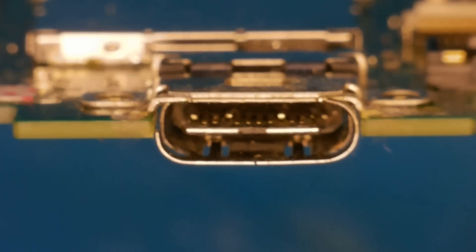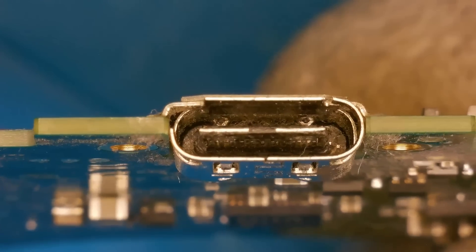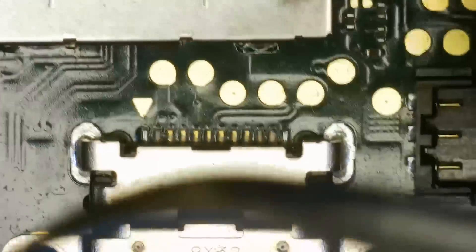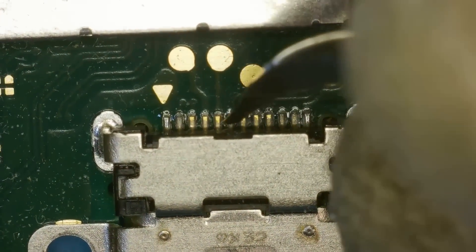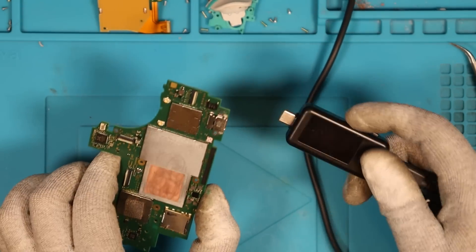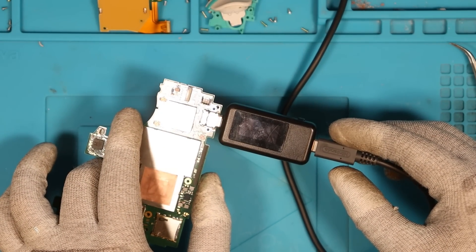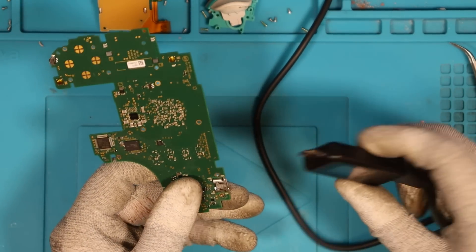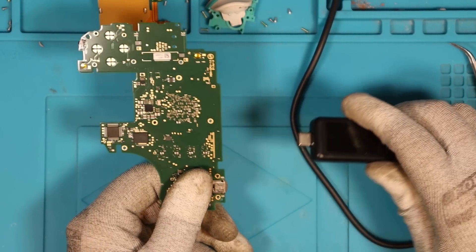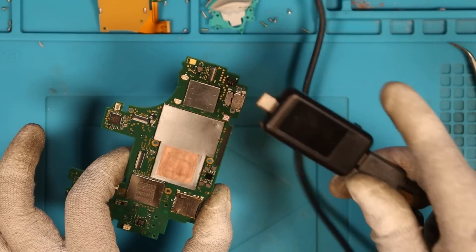It looks like we've got a couple of pins at the top that may have been pushed back — can you see how they're quite short? The other side actually looks hunky dory, all the pins seem fine there. Now checking the actual pins on the port — they are solid. Because the port doesn't actually look that bad, I'm going to use my ammeter to see what happens. We get nothing on either side, so those pushed-back pins may be causing it not to get the power it needs to charge or even recognize a charger.